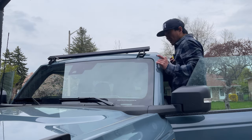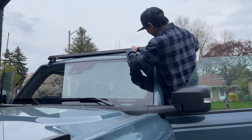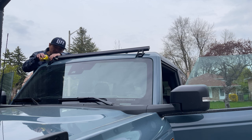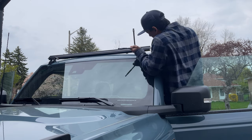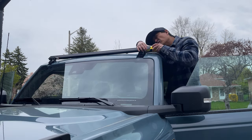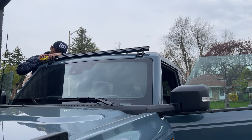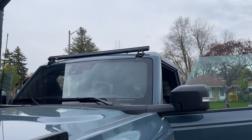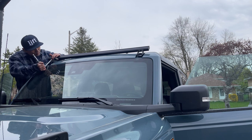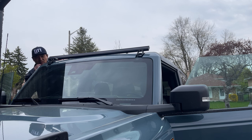So now we center it and it says 1.9, instruction says 1.92 inches on either side, which is pretty accurate. And that looks perfect, actually. 1.92 inches. Actually, it has to move over 1/16, or half a 16th, 1/32nd. Eesh. Okay, that's centered to the closest 32nd of an inch. That's pretty accurate. Or at least accurate enough. And I just realized why, in the instruction manual, they want you to be very careful about the torque measurements because everything's aluminum.